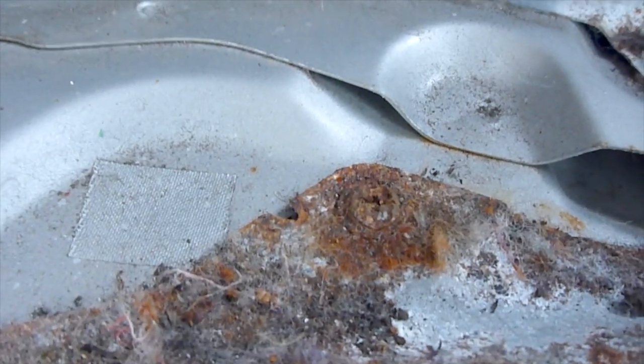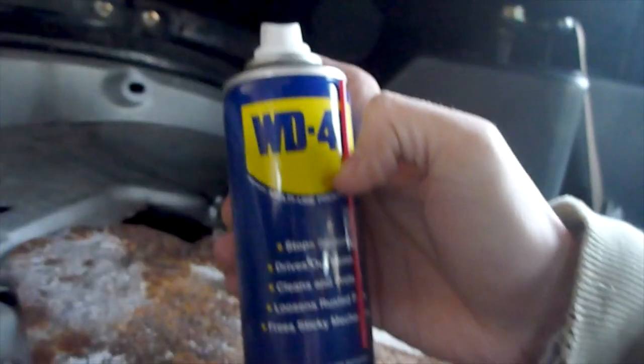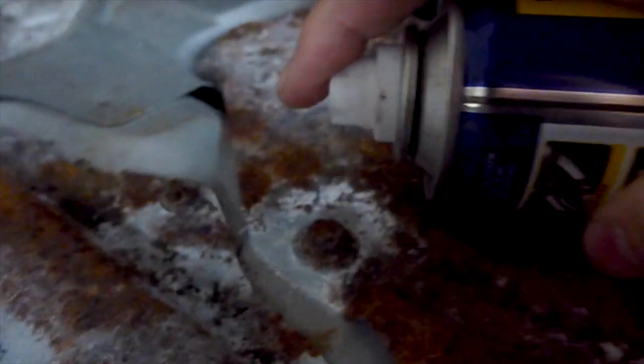One of the major issues I'm going to have is that these bolts all around here are all pretty rusted. And in fact, some of these screws that hold on the cover for the petrol tank are so corroded that they've virtually disappeared completely, which is a problem because obviously I've got to get them out in order to get this plate off. So I've got a bolt extractor set, which should at least work on these bolts. The first thing I'm going to do is just spray a bit of WD-40 onto them to try and loosen them off a little bit.